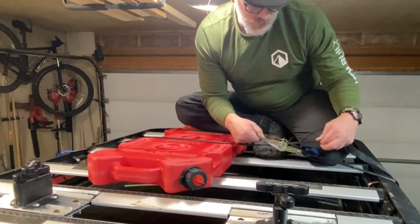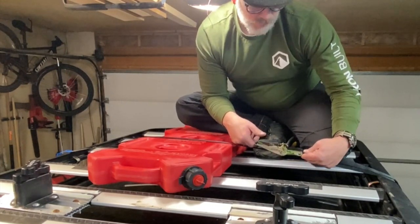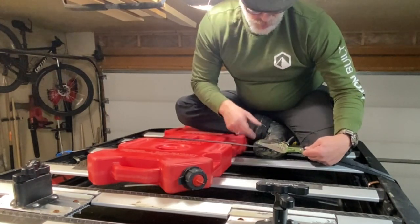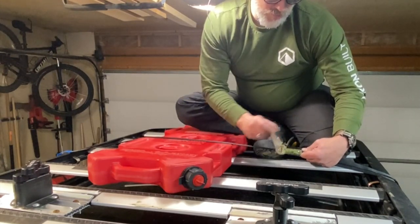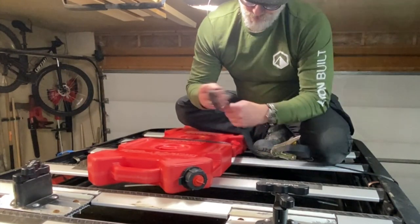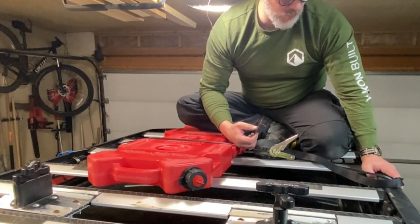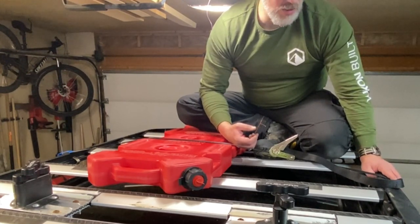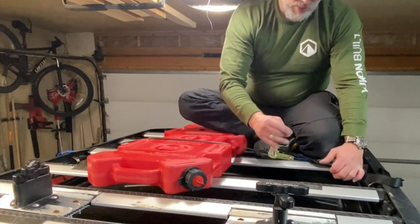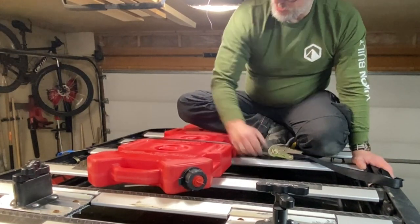It's very important to make sure this is all the way through and as tight as it gets. You can hold it down here — that's another mechanism — that way you get your finger out of the way if you hold it here, so you haven't got a lot of slack. Then just let it feed back through your thumb until it's tight. Then again you can take this little bit and put it down there out of the way. When you're securing loads on trucks you always use the side nearest to you. Then just give it a snug — one more — and there you are, that's as firm as it gets.